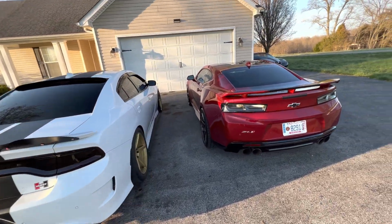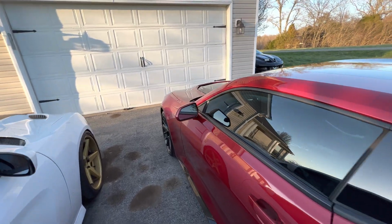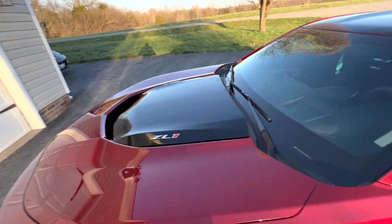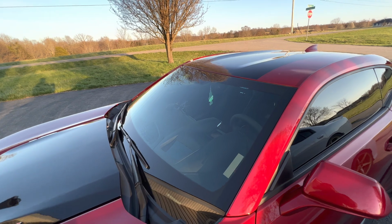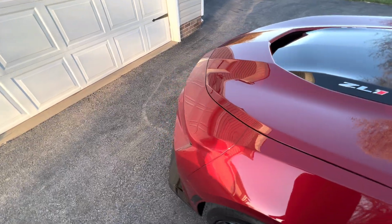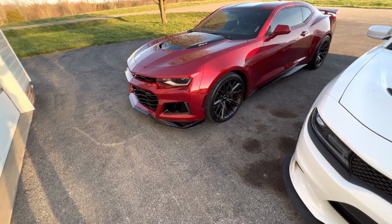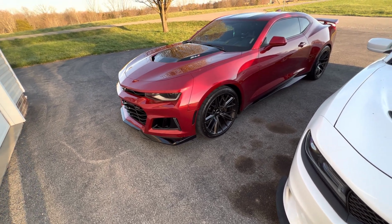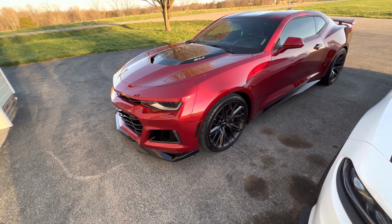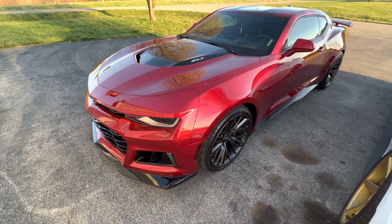But yeah, this car right here, even though it's down tuned so that it runs the nitrous and all that stuff, has the Lingenfelter NC2000, and it's got a progressive controller and all that stuff built in, and it's HP tuned. It makes a little bit over 850 wheel, full tilt, that's with spray, race fuel, the whole shebang. On the street, it's coming in around 670.